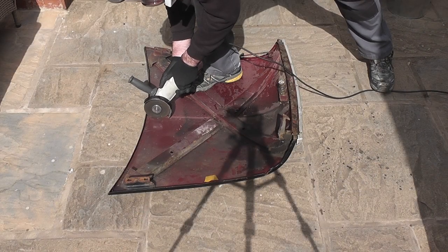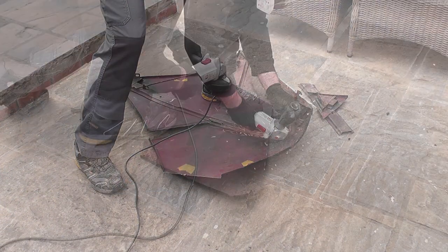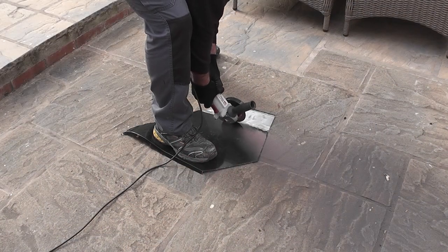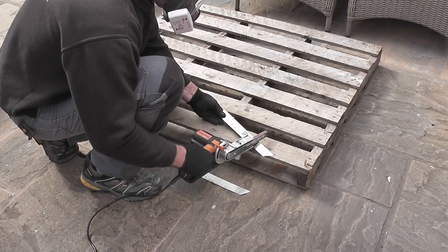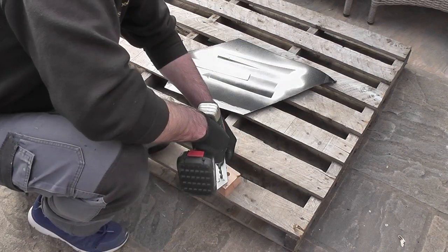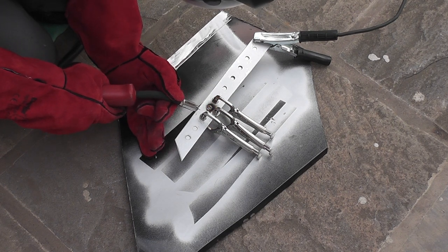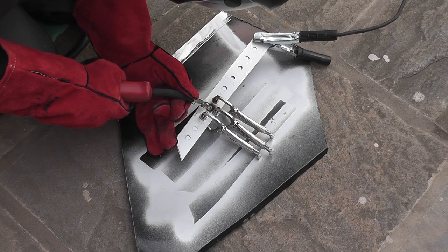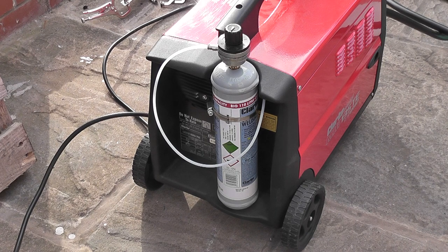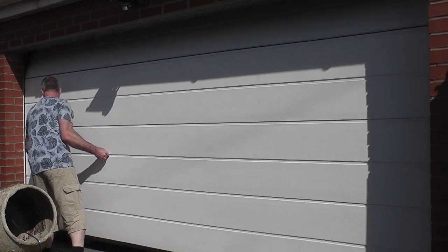Because I wasn't great at welding, I used a scrap bonnet and cut it down into strips to give me some pieces to practice on. I literally did hundreds of practice welds and really struggled, although a few didn't actually look too bad. I also swapped the CO2 for the argon mix and that really helped, but eventually I just had to go for it while the weather was nice and dry — and that's when I ran into a multitude of problems.